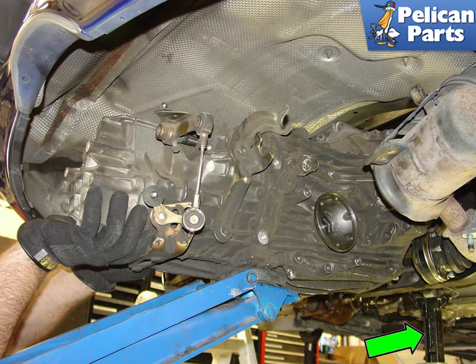Although you can do it by yourself, I highly recommend having a friend to help. Using your jack, carefully line up the bottom of the jack with the bottom of the transmission as shown. If you position it just right, you will be able to balance the transmission perfectly on the jack. Don't put your arms, legs, or face underneath the transmission as you are pulling it out. Once the main shaft disconnects from the center of the clutch, it will become really wobbly on your jack. Lower it to the floor carefully and pull it out from under the car.